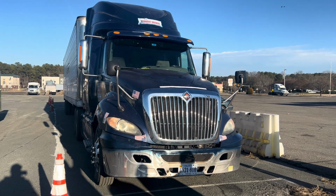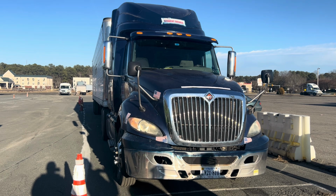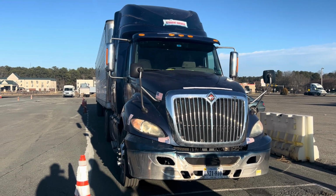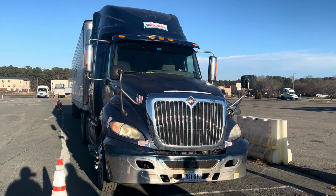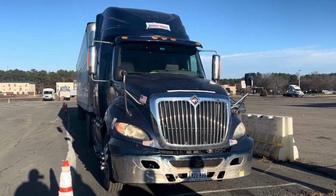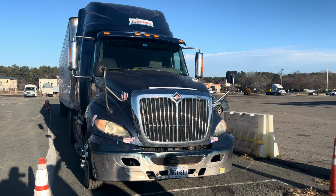Then I'll start from the top of the trailer. We call all those lights on the trailer clearance lights, because when you go over an overpass, they give you some clearance. They are yellow or amber in color, mounted and secured to the vehicle, not bent, broken, or cracked. I detect no moisture or condensation.